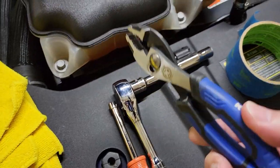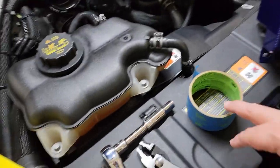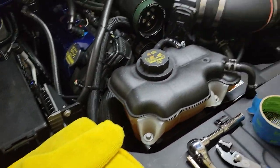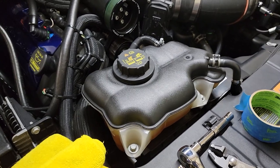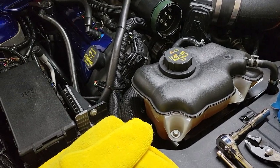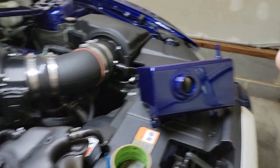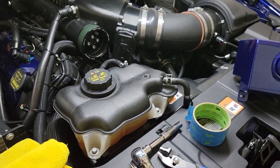Your little clamps you just need to undo. Now if y'all are wondering why I have some tape here — I'm going to try something a little different. Once you get these hoses off you do have your towels to pick up the residual, but you're gonna have fluid in this tank. So what I'm gonna do is block off the holes with tape so that if I do tilt it one way or the other it doesn't go all over the floor of the car. When I go to the bottom I need to put it on its side, get it mounted back, and then dump that fluid back in.